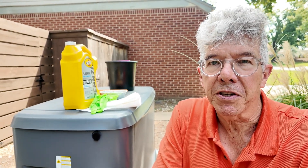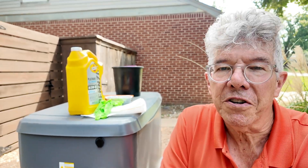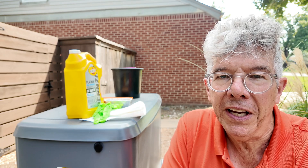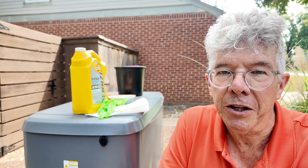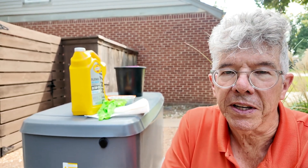Hey it's Michael here. About a year ago we got a 22 kilowatt Honeywell generator from Costco — they're basically identical to Generacs. It's been a year and according to the maintenance schedule you're supposed to change your oil after the first 25 hours of operation. We've only had a couple hours of runtime other than exercise time, so I'm well below 25 hours, but I do want to get the original oil out because it might have some minute metal shavings in it from being new.